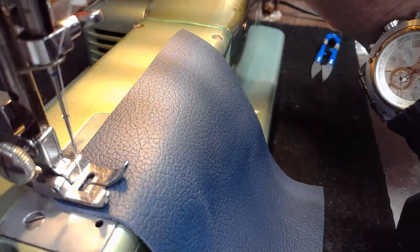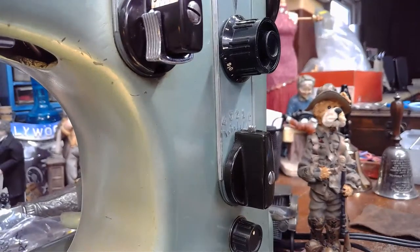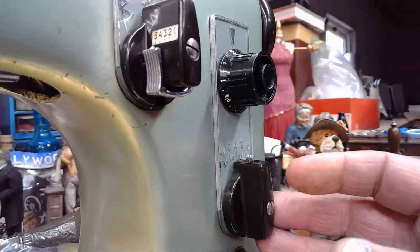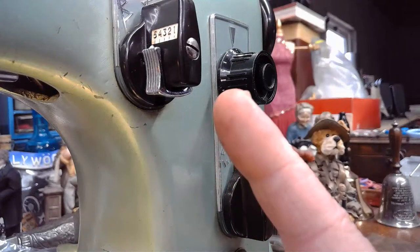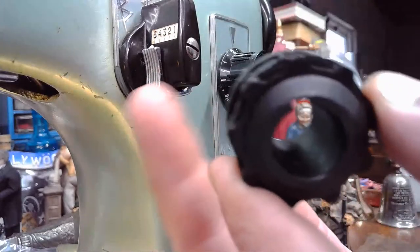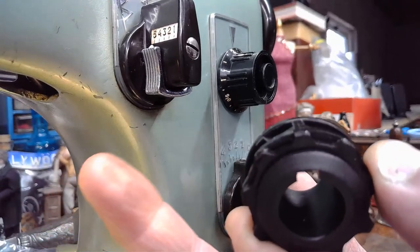All right, hold on a second. The other thing I should show you real quick, and I know I'm bouncing all over the place and covering a lot of stuff, is when we're operating with the cam, and right now we've got a revised cam B in the back of the machine, when we're wanting to use one of those cam features, we need to remember that we have to calibrate the machine, because again, I talked about that little reader finger that's on the right side of the cam when it's inserted in the machine like this. That little reader finger is either pressed into the cam or it retracts.